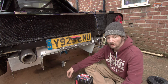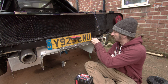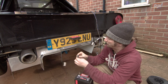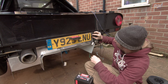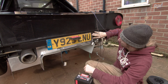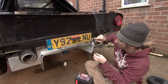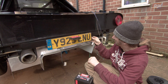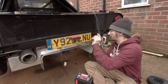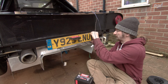To mount the number plate lights we've decided to hang them off the bottom of the crash bar — a slight change of plan. What we originally hoped was to mount them centered in the crash bar, but the rubber pad is just a tiny bit too tall for both bolt holes to fit inside it, so you have to drop it down. At that point we figured we may as well centre-align it with the number plate and let the wires come out underneath, which saves drilling through the crash bar. We've got a couple of little metal brackets to weld on after cleaning off the paint, and then we'll have a nice area for the number plate lights to fit onto.